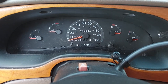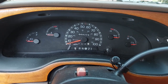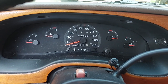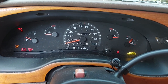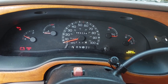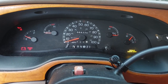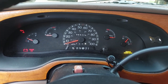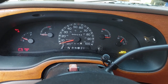It's been about a month since the last segment on this, so I want to go ahead and wrap this up. There are two things we're looking for: we want to see if the ABS light turns on when we put the key in the on position — it will initially turn on, then it does a test. You'll actually hear the ABS pump go through a quick self-check, it makes kind of a grindy sound. And you'll see there's no ABS light, which means it went through its basic self-check and it's fine.